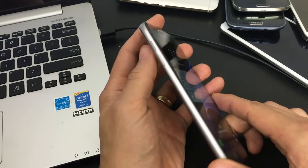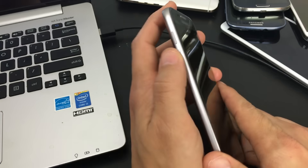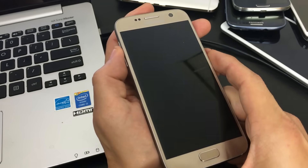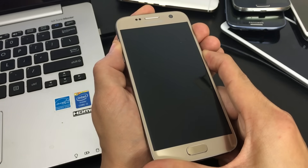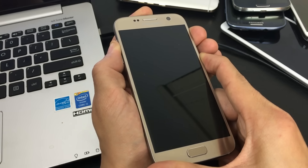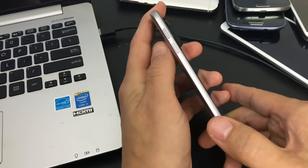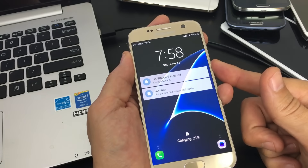Steps five and six: press three buttons at the same time — volume up, volume down, and the power button simultaneously. Figure out how to position your fingers depending on where your buttons are on your particular phone. Press and hold all three until the phone reboots. Some phones will do absolutely nothing depending on the brand. If it boots, wipe your cache partition. Step six is the same but with the phone plugged in.